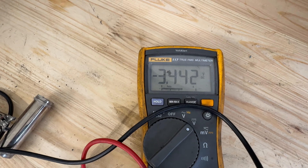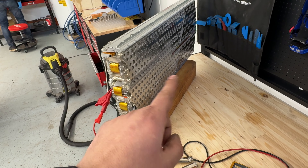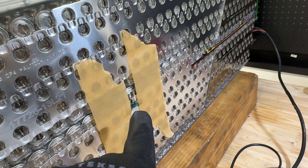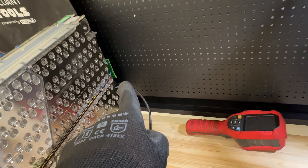The new cell is installed. We are now balancing the brick — currently at around 3.44V — which will need one to two hours to recharge. We should be able to finish the complete battery pack — cell extraction, change, balancing, and assembly — in one day. The fuse is welded and protected against galvanization issues, and we're now directly connected to the BMS.